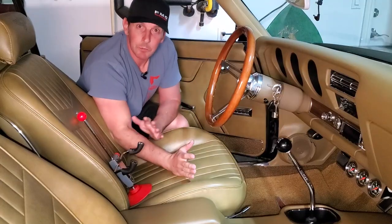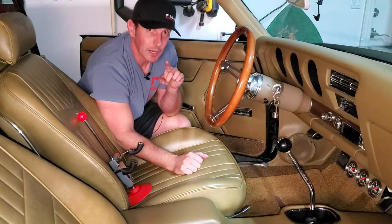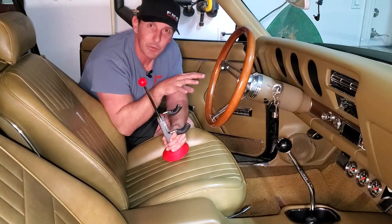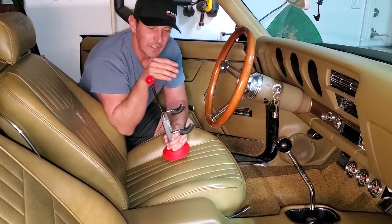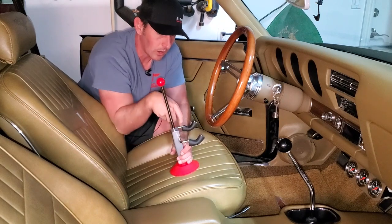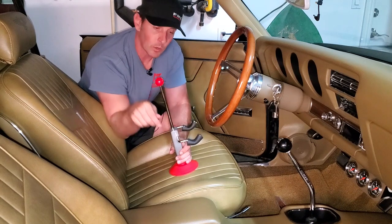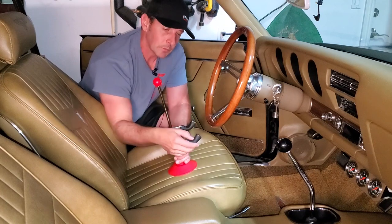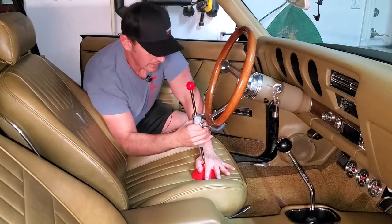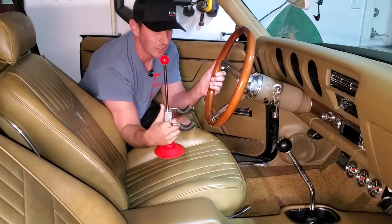Now I'll show you how to lock the steering wheel. My pitman arm is perfectly centered — hopefully yours is too, or your rack or whatever. If you have a new car, center your steering wheel. We have to lock the steering wheel in place because we don't want to change the toe and realize the steering wheel was moving the whole time — that'll mess up all your dimensions. Get this Quick Trick steering wheel lock. The standard one has steel arms for a padded steering wheel; for a wood wheel like mine, coat the arms with rubber tubing. Push up against the wheel with the fingers, push down on the seat — the steering wheel's locked. Stay tuned for that discount code.